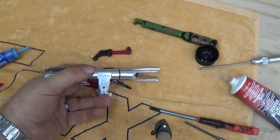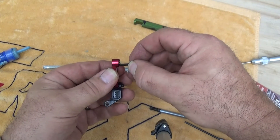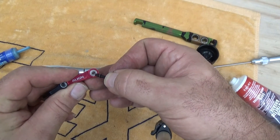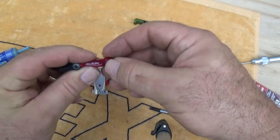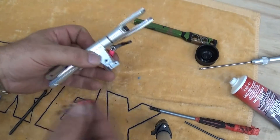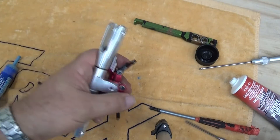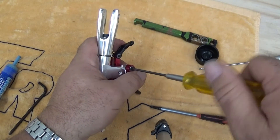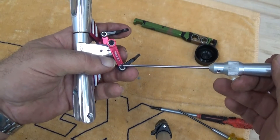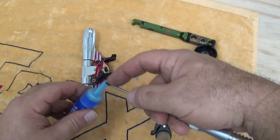The last piece to go together on this rotor head will be the swash driver arm. Two pieces here — the 10 millimeter bolt, and on the outside of the arm there is a tiny little washer. This washer is very important — this keeps this bolt from binding up the outer race of the bearing, so the washer just connects to the inner race of the bearing. It gets assembled with the Align logo facing up, with thread lock, and it mounts to this boss right here on the rotor head, which takes care of the inner surface of the bearing so it doesn't get bound up. Align's done a great job making this much simpler. Each side of the actual swash driver plastic arm has a small bolt — use your one and a half mil driver — coming through with just a tiny bit of thread lock as usual.